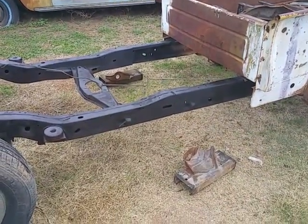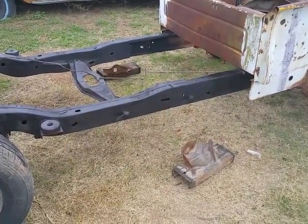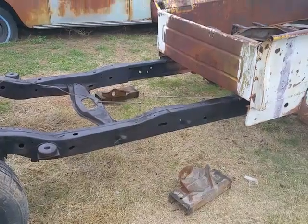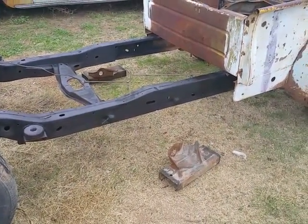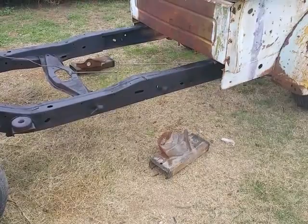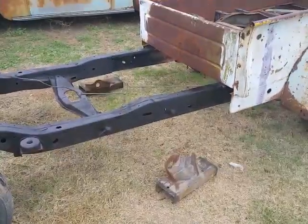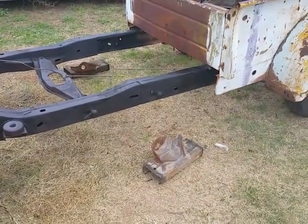About two hours ago I decided I was going to shorten it today, so I put it in position, put some jack stands under it, cut out my piece, ratchet strapped it back together, clamped big beams along the length of the frame. Because I was utilizing a nice straight part of the frame, I ratchet strapped it back together, rechecked my wheelbase — everything was good — welded it back up, and threw some black paint on to make it look pretty again.